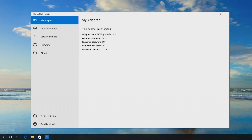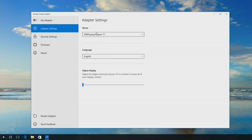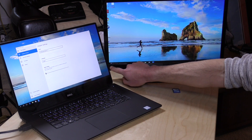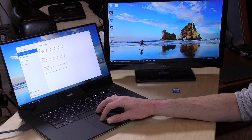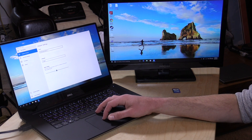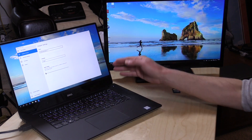Now I want to show you how to configure it — you can only configure it on Windows. The Display Adapters app lives in the Windows App Store, so you need Windows 8.1 or better to download it and make configuration changes. It will work out of the box without it, but this app adds important settings. You can change the name of the device, adjust language settings, and there's a really important overscan setting. I can drag a slider to change the zoom of the image so I can actually reach my Start menu on TVs that cut off the edges.